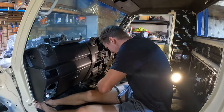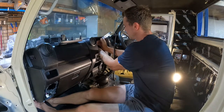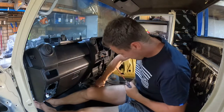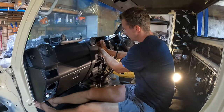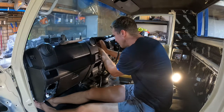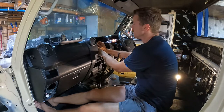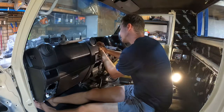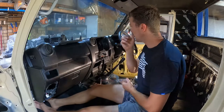Now that should give me a decent earth. There's a yellow wire here - let's hope it'll be that one. No. Red. Nope. Maybe my negative's bad. Bad earth - as per every Facebook group. After finding a better earth point, the small red one lights up. So the small red wire is our constant power. It's a good idea to have a pen to write these down.